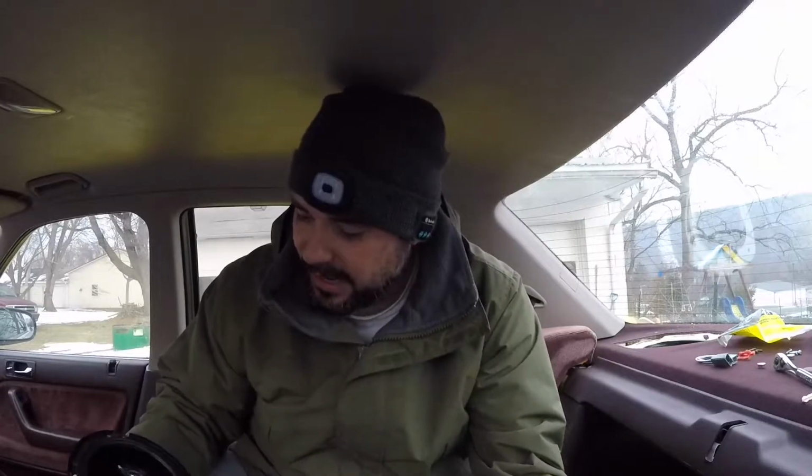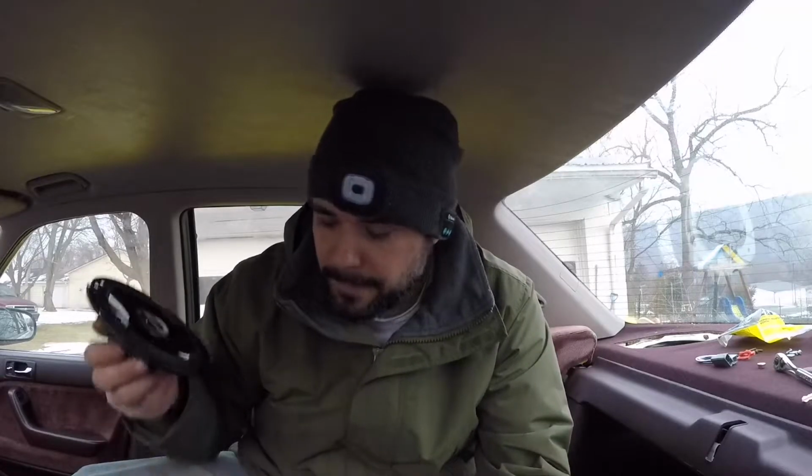That was especially important for the front speakers because you have the power window that goes down, and you just don't want the window to touch the back of the magnet here and cause you power window issues in the future. So that's why I went with this design, and it just turned out that it was really cheap. This was actually one of the cheapest speakers I could get. The factory speaker says it's rated at like 30 watts. This one says it's rated at 300 watts. I'm sure it probably isn't the best on the market. I'm sure there are better speakers you can get, but it was the closest to the original I could get without having to go and buy an original speaker. So that's the speaker I went with.